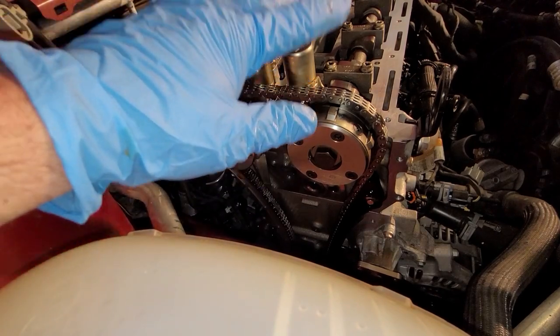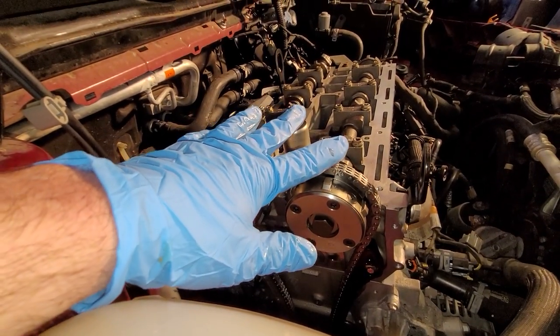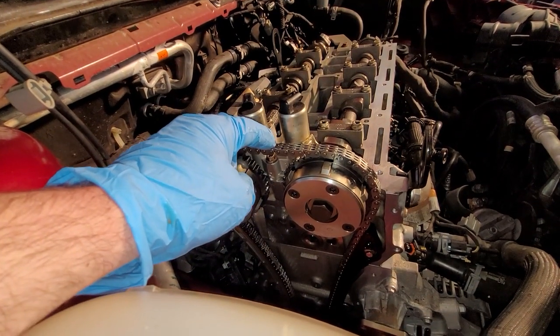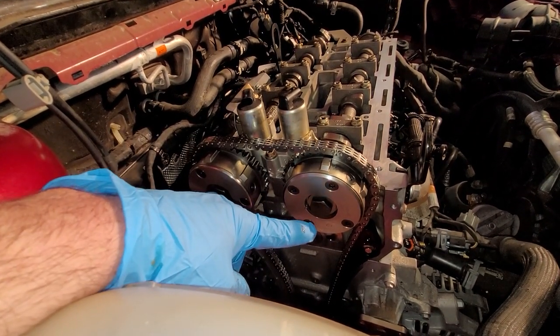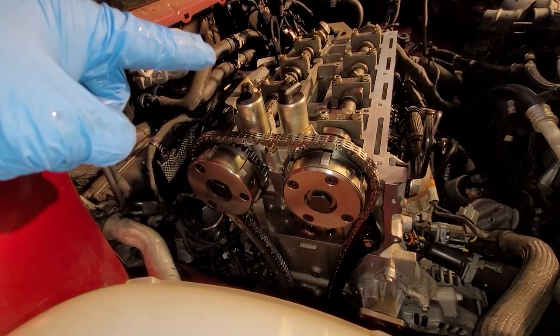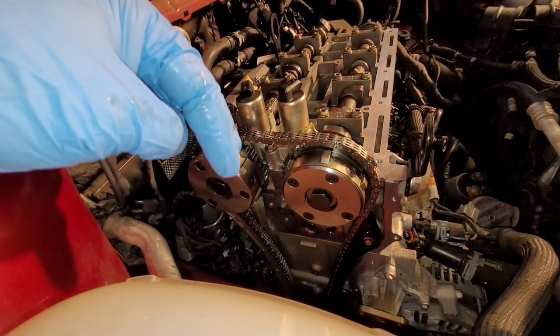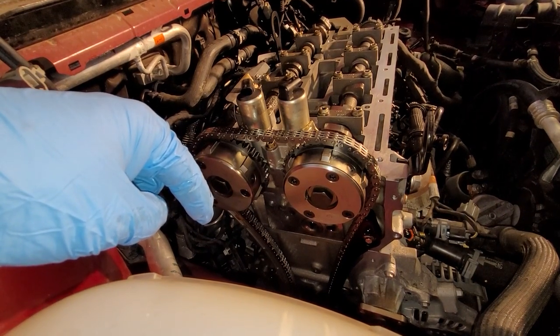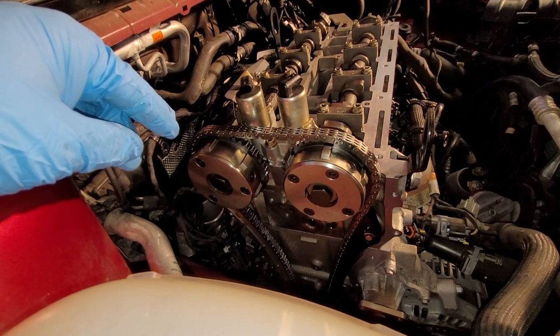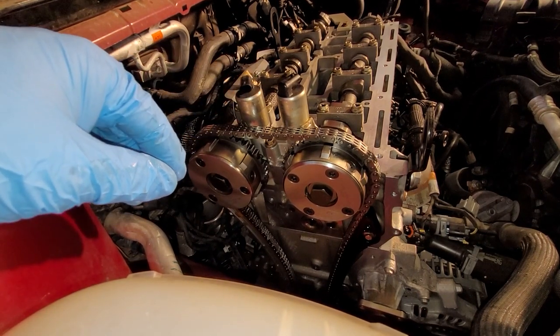Because these didn't fail, and I didn't have to take them off, I'm just leaving them in their position, and by putting the cams in their locked position, the chain just draped right over these things and is in its perfect position. So I'm not gonna loosen these and torque them. If you want to see that procedure, again, I've linked it much earlier and it's down in the description below. Look at the Discovery Sport video, and I talk about doing this timing setup from a fresh engine perspective.